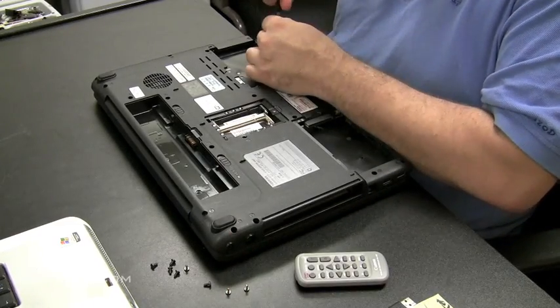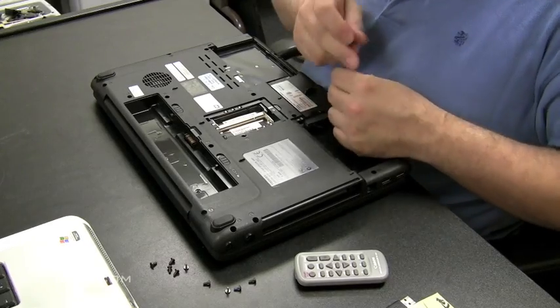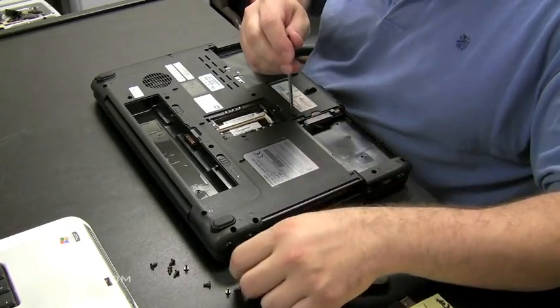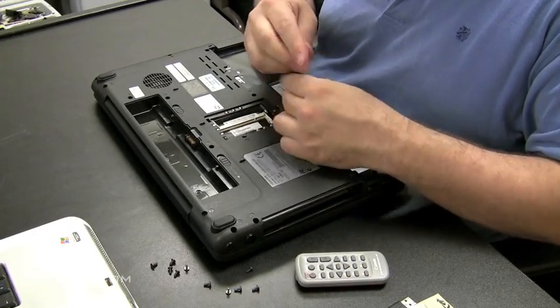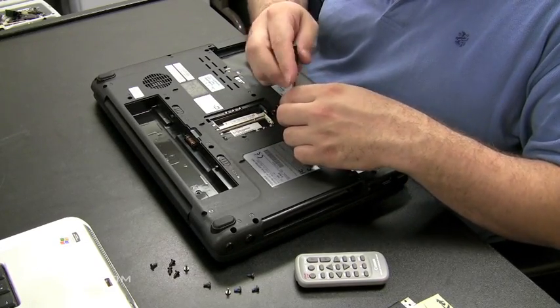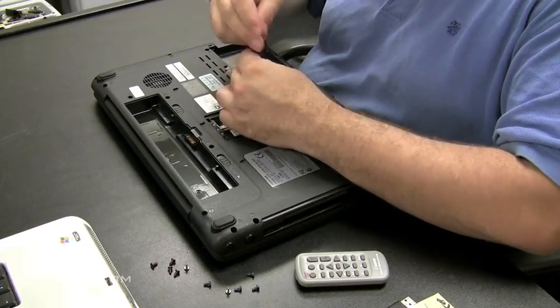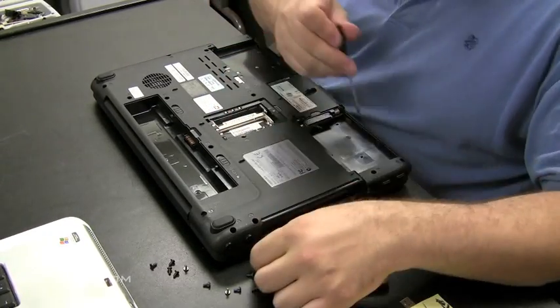Look at the motherboard in every little crevice — that's what we're going to do, and that's what I recommend on water damaged laptops of any sort. Don't power them on, and even when the customer comes in, don't let the customer power them on when it's in your shop. They brought it in because it was damaged by water, and it can't get any better if they're sitting there trying to charge it with power.